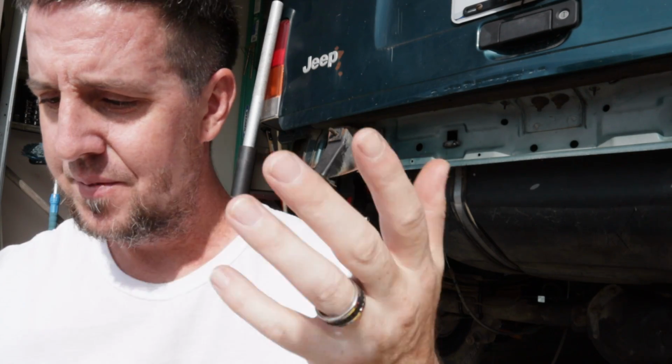But while I've got that flame on there, I'm taking a screwdriver and tapping the hard line. Just tapping it, sitting there holding the torch and tapping the hard line, hoping that this thing will finally pop loose just a little bit. Because whenever I put the wrench on and gave it that first initial turn, the whole line started to twist. If you keep going, you're going to break your line. You're going to have problems.